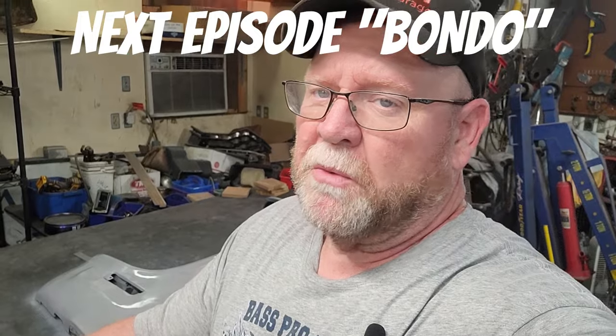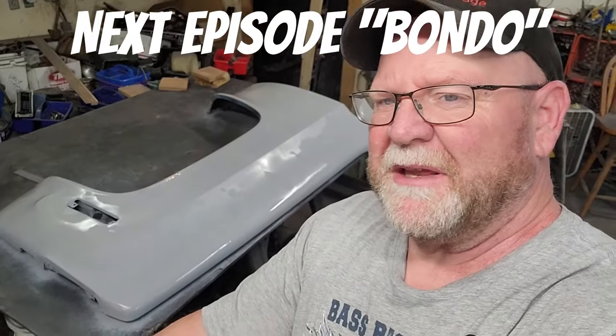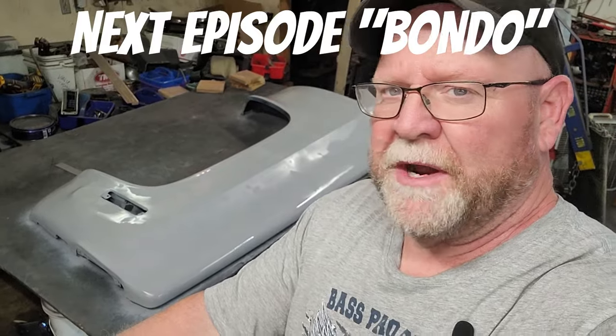You DA it down, find your bad spots, hammer them out, smooth them out, and then DA everything down, and then hit it with some primer. Some guys use filler, some guys use build-up primer. I like to use a sealing primer or an etching primer if I have metal showing. It just seems to work better. But then I've got a can of filler primer ready to go for when we start block sanding this. But we're going to leave it be for 24 hours in the shop, shut up. No dust, no air movement, just leave it alone.